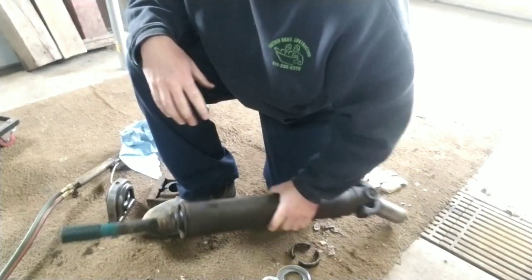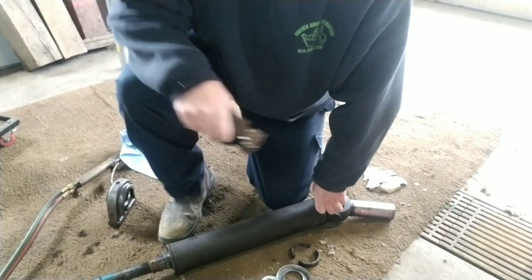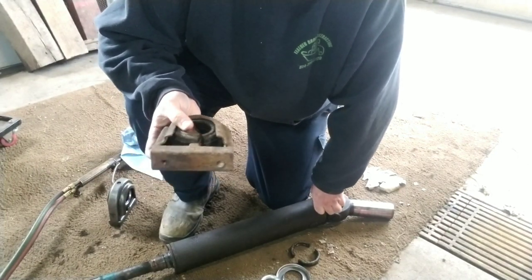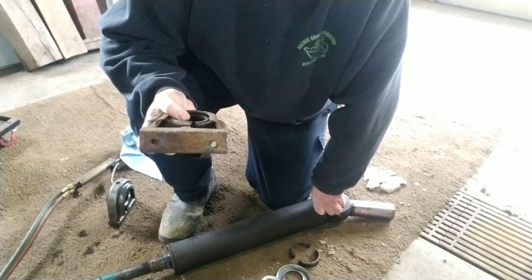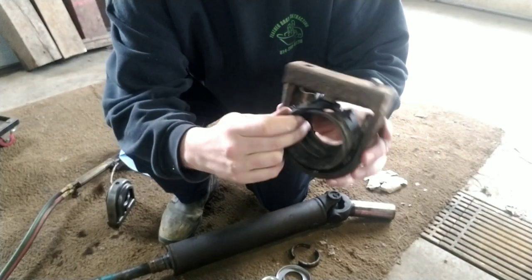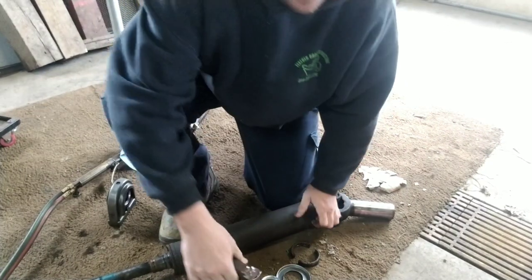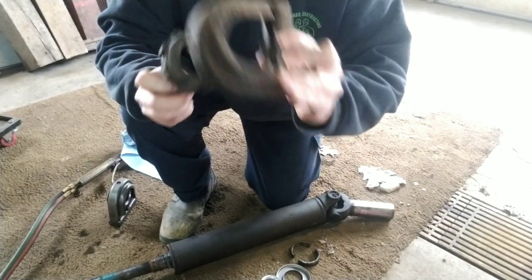So you've got to measure that size first. If you have any kind of vibration when accelerating — I thought maybe my clutch was getting bad again, I just put one in — if you have any kind of bad vibrations when accelerating, you can get under and wiggle it. This is the original one; I already cut the rubber out, but the rubber bushing was bad. The bearings weren't too bad though.